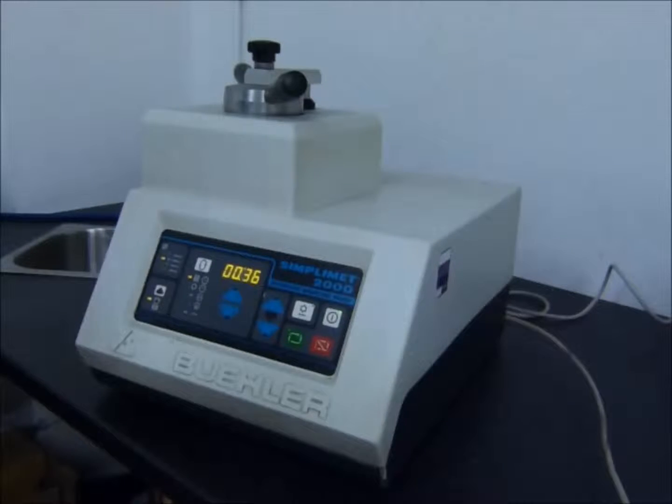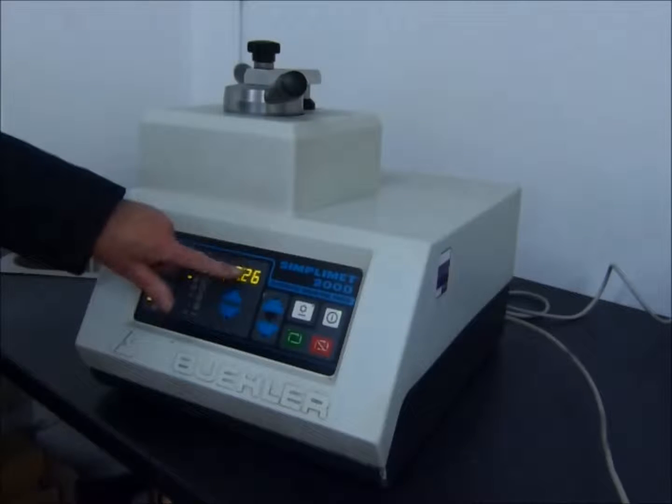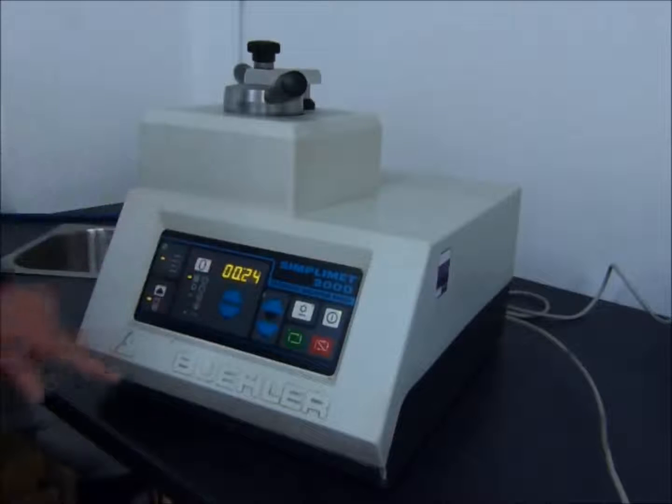As you can see, we're now down to 35 seconds left of the cooking cycle. When it reaches zero, what we should see is this indicating light showing that the cooling part of the cycle is operating, resetting to the three-minute cooling time and then counting down. You will get an issue of steam from the waste pipe — this is just because the cold water is going into the hot cooling jacket to cool and turning to steam. It's entirely normal.